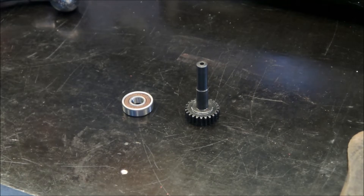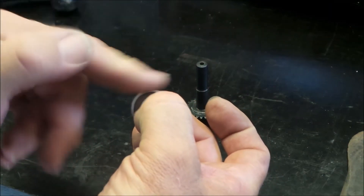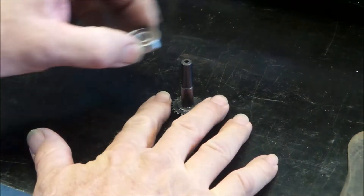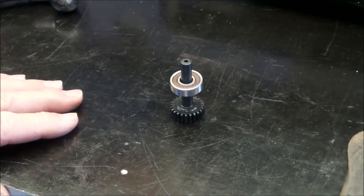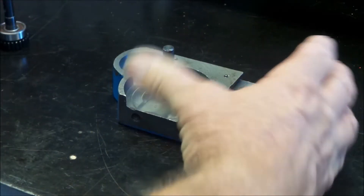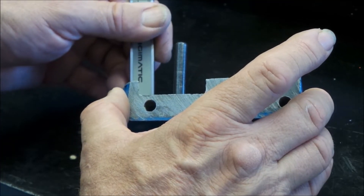And there you go. Through the magic of YouTube the bearing is now off. Nice new bearing. I have a special technique for pressing small bearings on like this — I mount it in position and just hit it down really hard on the bench and it'll go down. Like this. There it is. Now I think it's time to measure the casing. She should fit, but only just.